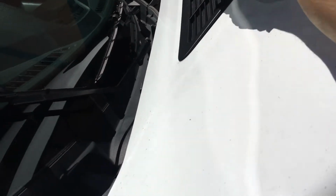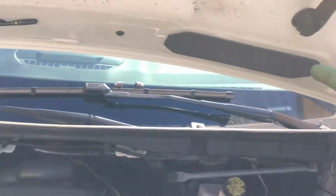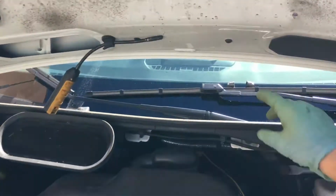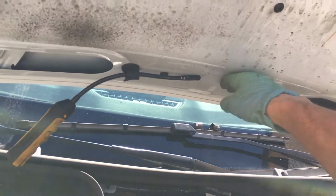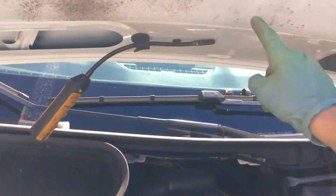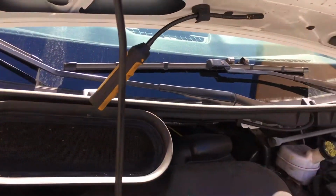And actually this one is sealed off. It pulls the cooler outdoor air right through here, and it goes across, and then it goes down inside. Their only mistake is that it will be about 160, 200 degrees under here, heating that air by the time it gets here. So this needs to be insulated if this was my vehicle.